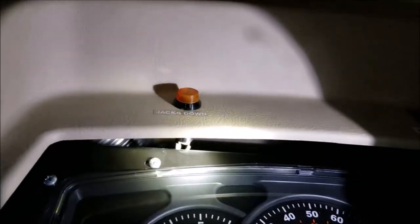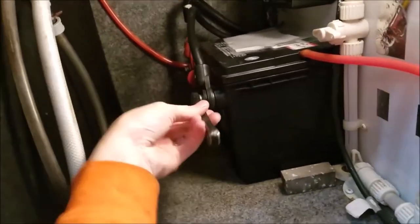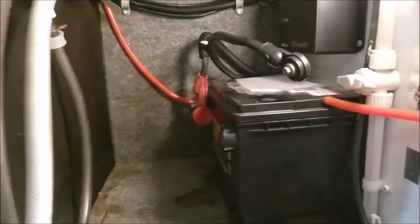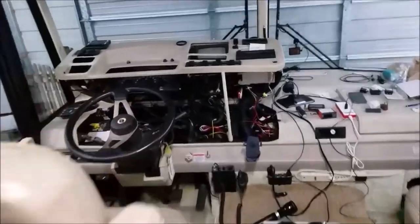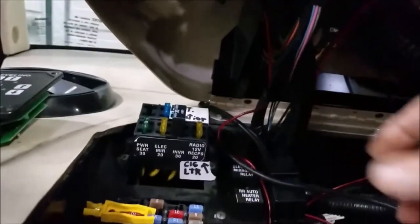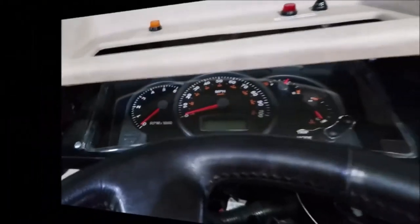I've moved my battery over here into the basement area - I've got a handy little ratchet wrench for stuff like this - and now the engine starting battery is disconnected. Hopefully I haven't popped any fuses. That should probably be step one when you go to do this - unhook the engine battery so there's no possibility of shorts. Also, when you raise the dash up, check your wiring harness and make sure you're not pulling anything really tight. I've read of people having to redo harnesses because raising the dash was tugging on them really tight - you don't want to unplug anything. So just go slow and be careful.